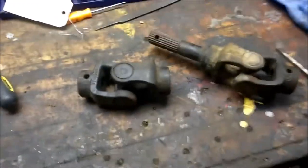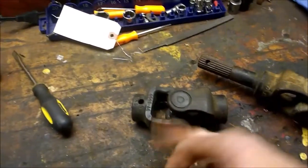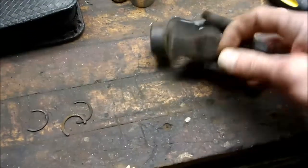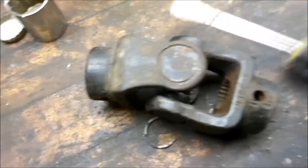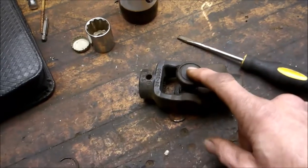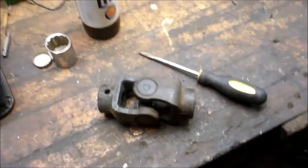Ironically enough, if you search up the part numbers, they're both the same part number. So you can go on eBay or wherever and buy two of these — I bought two of these. They came with a U-joint for $35 a piece. I already started taking the clips out. These little clips go in right behind here, so what you do is take a screwdriver and a hammer and you pop them out. If you just wanted to replace the U-joints and your yoke was still good — my yoke was shot — but if your yokes are still good, you can just punch that out and put a new U-joint in and slide that back together and you'd be good to go. Unfortunately, I'm not that lucky.